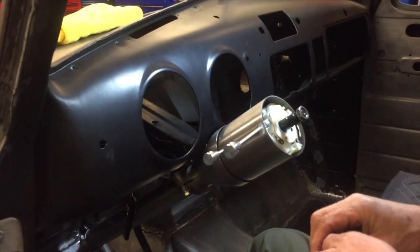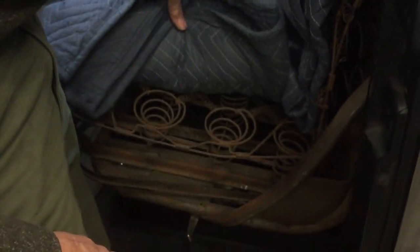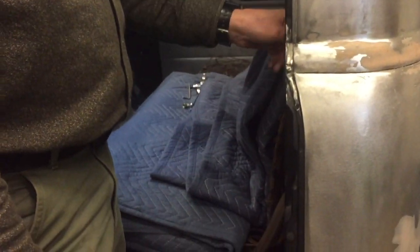Let me get the steering wheel — I've got to show you that. When you're getting ready to figure out your steering column, you need to really have either the seats you're going to use or something pretty close. I haven't decided yet, so I put my original seat back in with some Harbor Freight moving blankets just to simulate a seat. I tried a milk carton — doesn't work. I tried a five-gallon bucket — it was too high, my head was hitting the roof. If you've got your seat, put it in, because you'll need that to get your column exactly where you want it.